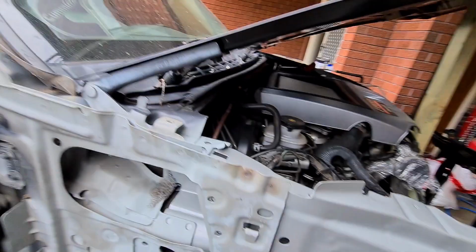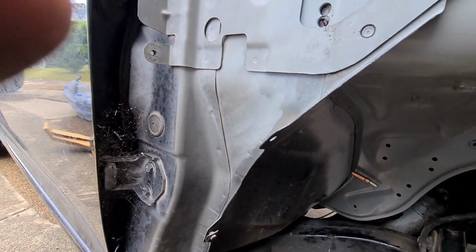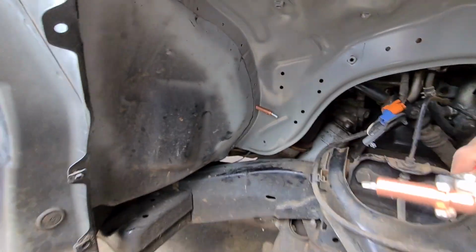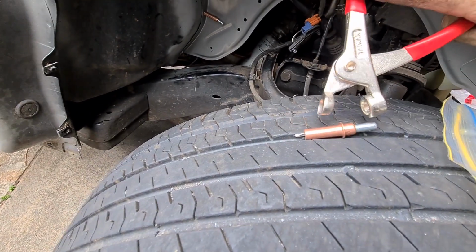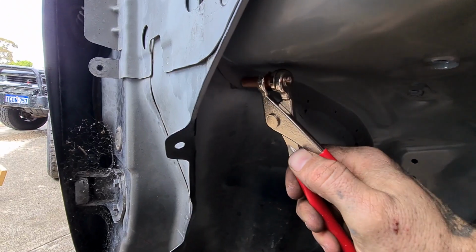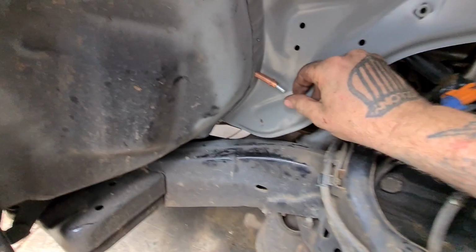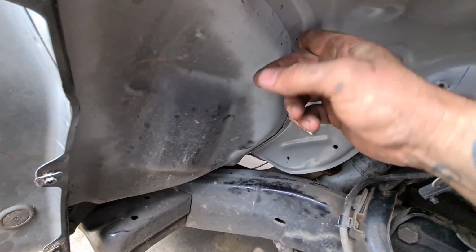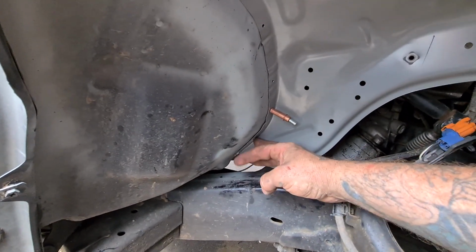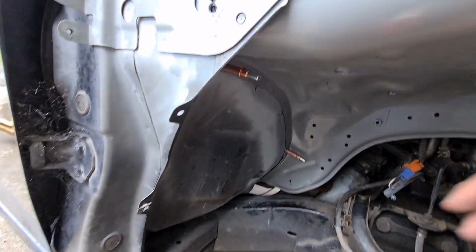Before I mentioned a Cleco and spot weld with the MIG versus with the pinch welder. So this is a Cleco, just slots in there, drill your hole where you want to hold the thing, and there you go, little temporary rivets. So I don't need a lot because this is actually fitting quite nicely. I'll massage that in a little bit. They're never going to be the same as what this is. These two were never grafted to begin with. This is the first time they're marrying.